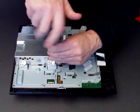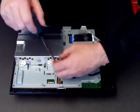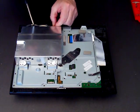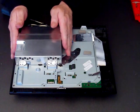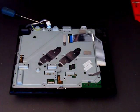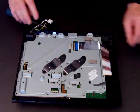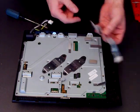Next we have to remove the PSU, or the power supply unit. It is held in place with five screws which are all pretty easy to take out, and it just lifts off. Then disconnect it at the back, put that to one side. There's an earth screw here — just unscrew the earth screw, it slides back and pull it to one side. Then take off your Blu-ray data ribbon — that just clips up and out it comes.